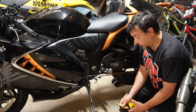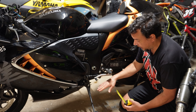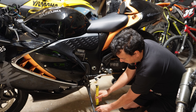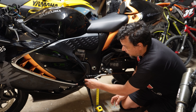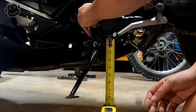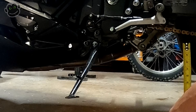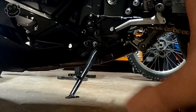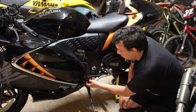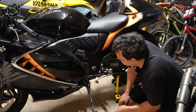To reverse the shift pattern you just go from like so to like so, but the countershaft sprocket is in the way. One thing you'll want to do before doing what I just did is take a measurement of the height of your shift lever — lock it into position — so when you put your shifter back on you can get it at the right height and it'll feel the same as before any changes. The other thing is you don't have a lot of slack in the quick shifter cable here.